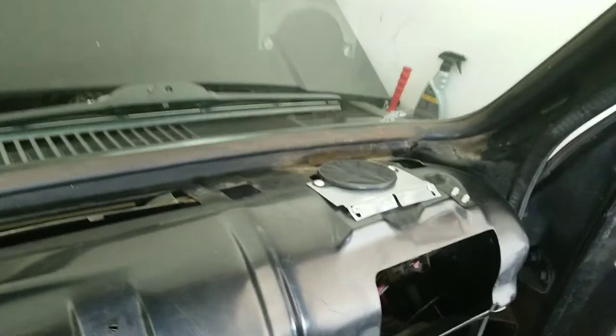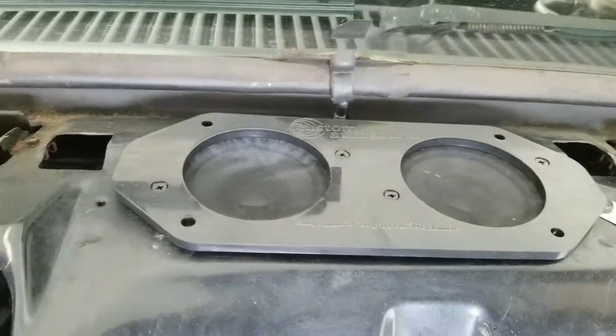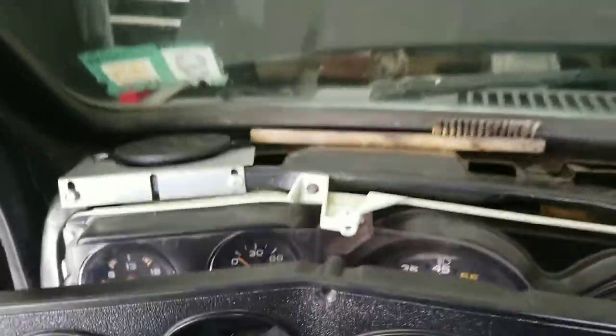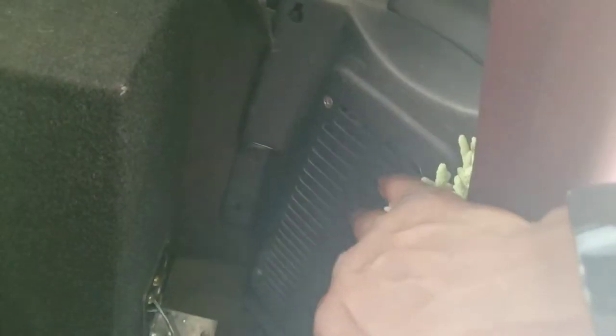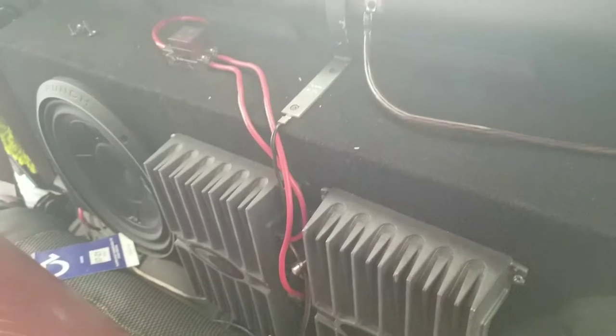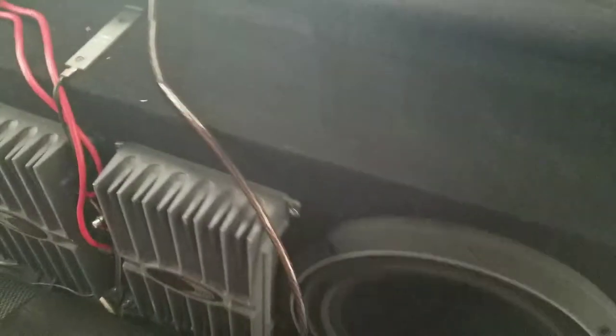I got the speakers installed. I opted to go with the center dual speakers in the middle — one wire to the right side and the left side wire to the left side, so you still get that nice surround sound. I got my dual voice coil speakers in the back, 4x10s. I got this box just so because when it's insulated you can get some bump out of them in this little corner — so if you're not running an actual sub system in the back of your truck. I'm organizing wires a bit better. I got a ground connected but I haven't hooked it up yet — I'm gonna buy a distribution block and run the grounds off of that block to each amplifier for a nice clean look.